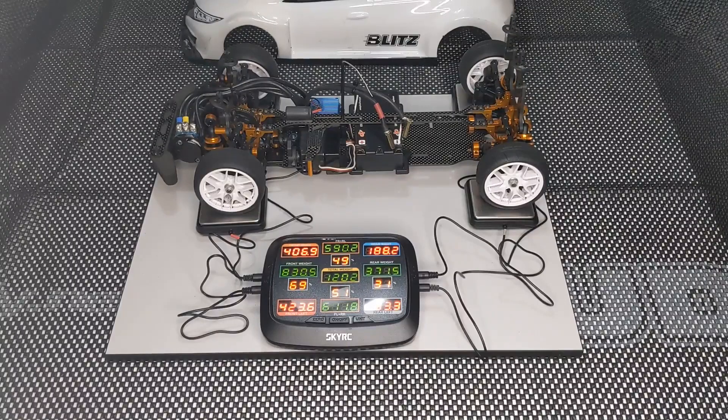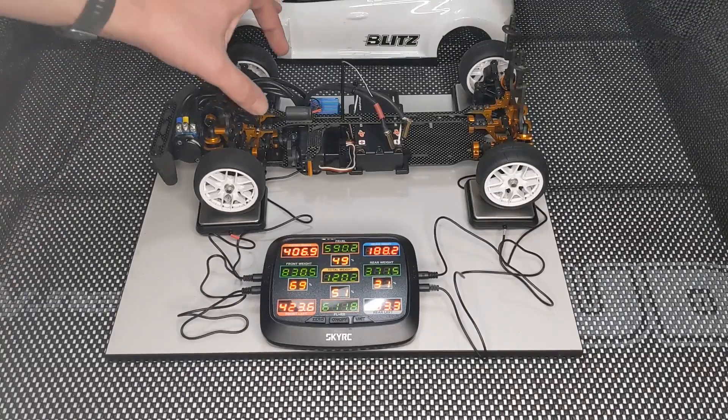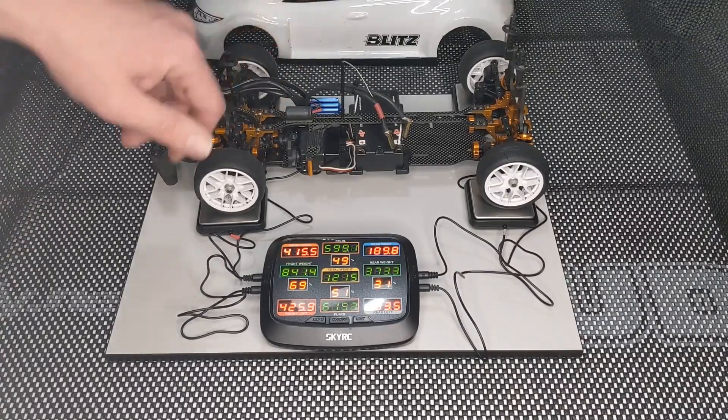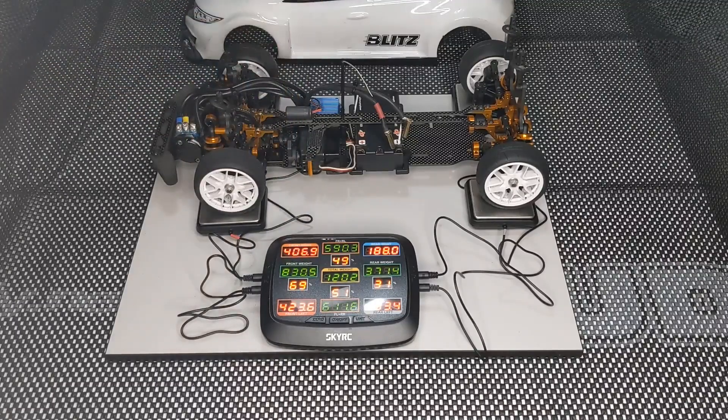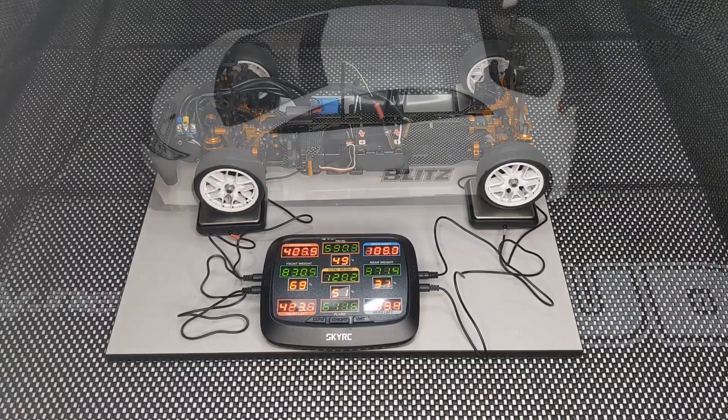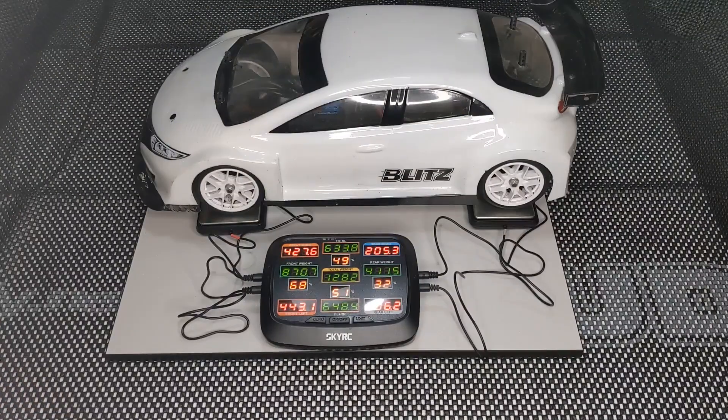So here we have the 2019 car with the front motor ready to race, more or less. I'll just mention a few things about the weight on this car — it's not completely out of the box. There is some ballast already in front of the speed controller and in front of the servo, about 10 grams here and about 55 grams here. We'll just add the body shell now so we get it properly up to race weight. We've got a total running weight in this spec of 1282 grams, which is slightly over the 1250 gram minimum.